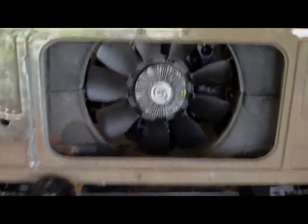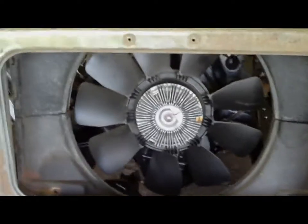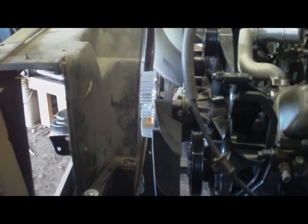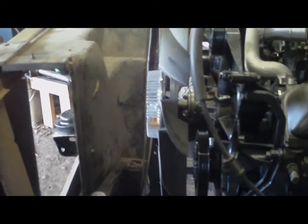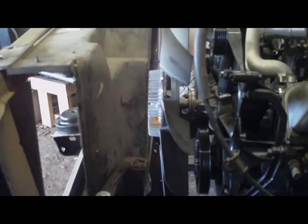Okay, here's the 6.5 liter van shroud. It actually works really well for this fan. Now, not in this position though. It looks like it wouldn't be a problem if I moved the engine forward 3 inches. That would work. That would be pretty much the same way that the original engine sat in the van. So I'm not going to feel too bad about moving that 3 inches forward, and that cures instantly all of my clearance problems here, I think, quite nicely.